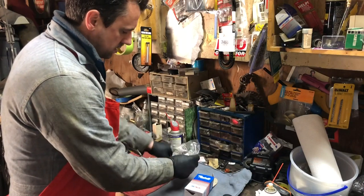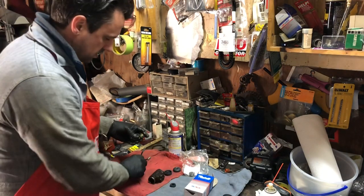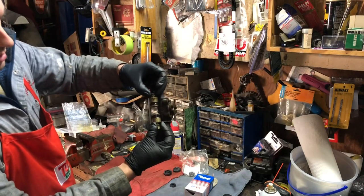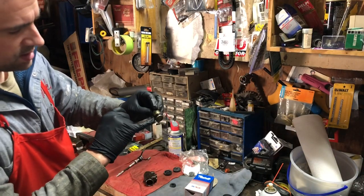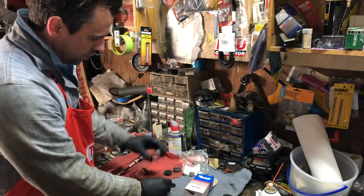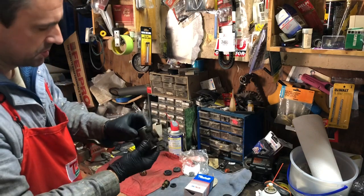What we're replacing are the two end boots and also the piston rubber pieces right here. These are the two pistons that run inside the cylinder. As you hit the brakes, it pushes them out, and the pressure is maintained by this rubber seal on each piston. So those get old. The rim in here will start rusting. If you let the car sit too long, it gets a little bit of moisture there, and that surface rusts, and then fluid spills past it.